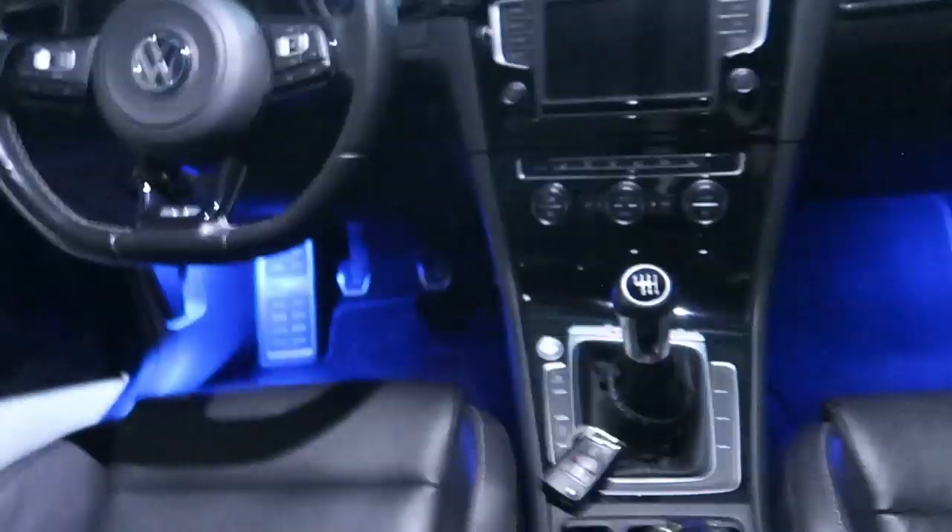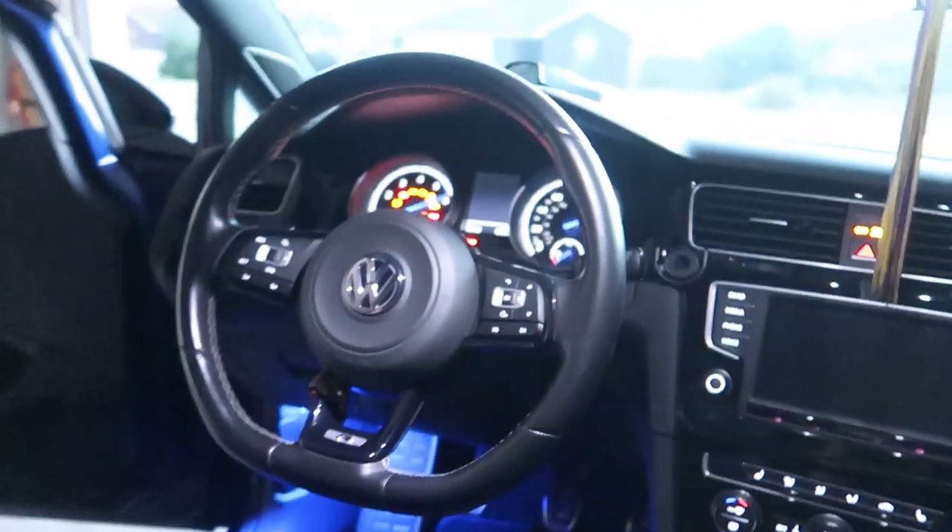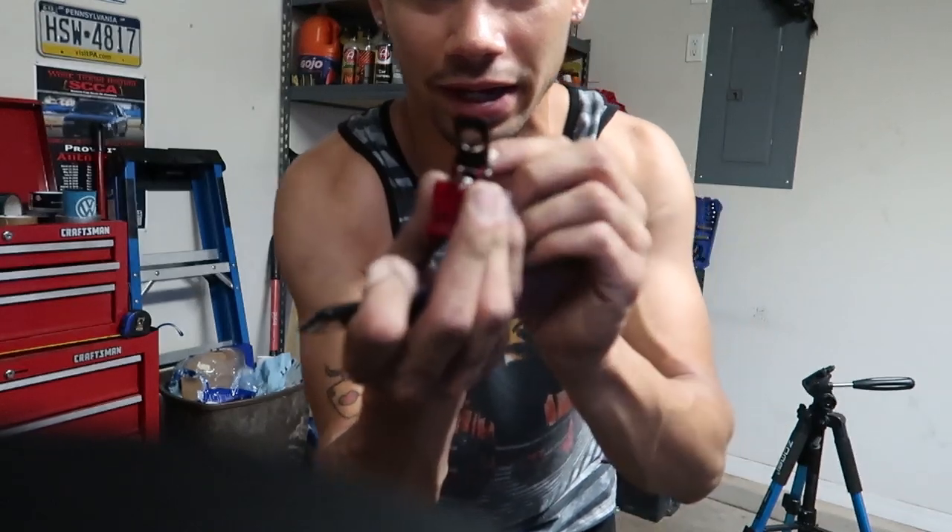I switched the wires around — testing — system ready. After about five minutes of being confused I realized switches are made to be a switch: on means you're allowing power through, off means you're not. When it was set to off it wasn't allowing the Haldex to be on, so it was the opposite of what I wanted. Basically there's a little tab in here — I cut the tab off since it was just for alignment — and I flipped the switch upside down. Now it works. I'm gonna cinch it all down, put everything back together, and then go for a drive. It's pretty much dark now but I'll see what I can do.